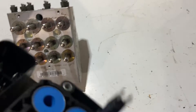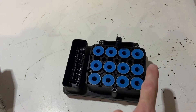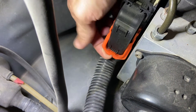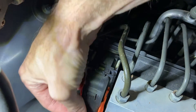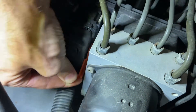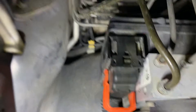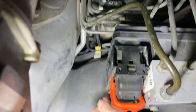Note there is a little electrical connector that slides in there and there's no fluid or anything, but you want to make sure when you take it off there's not any dust or dirt. To get this unplugged, there's a little push tab, a little serrated button. You have to push that in and it releases this lever and you just kind of have to rock it upwards. Because a lot of dust and dirt and grit get in here, you kind of have to work at it — you can just rock it up and down. You might even be able to spray some contact cleaner down in here. What's happening when you move this is these little white blocking tabs are going down to release this. Just keep working with it — and there it finally released. Now I can wiggle this off. There we go, this is unplugged now.